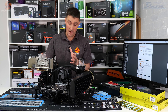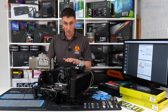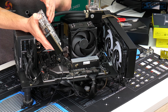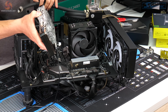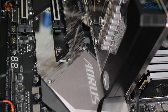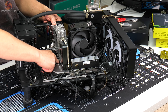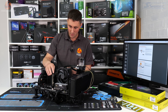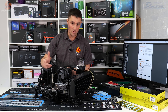This next issue probably won't affect many people since I doubt anybody will be running an air cooler with this water block — but it's an issue for me. I had to spin the terminal block 180 degrees because in the stock setup the outlet was too close to the air cooler. Also, when the card is installed in the PCIe slot, you can't get to the retaining clip on the back of the slot when you come to uninstall the card. You'll probably have to wedge a screwdriver underneath to release the locking mechanism — something to think about if you ever need to disassemble your system.